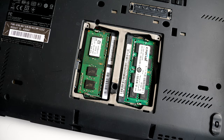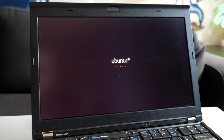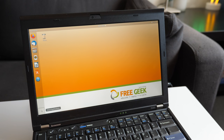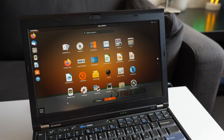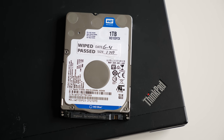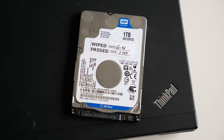The machine came with 8GB of DDR3 RAM, so I didn't need to worry about that. FreeGeek often installs Ubuntu Linux on the computers it refurbishes, and that was the case with this one. Not only is that operating system free, it's also generally considered to be more lightweight than Windows, so older computers can perform better. But even so, it felt a little sluggish on this machine — it took a few minutes to boot, and even at the desktop, there was some lag to the user interface. So I spent the last $20 of my budget to fix that. There was a 1TB mechanical drive already installed in the computer, which is only ever going to perform okay at best.